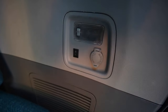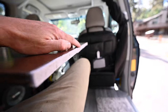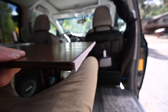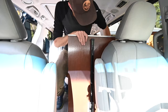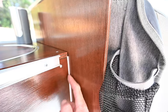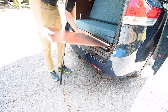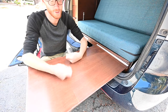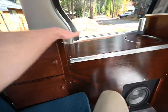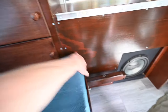Those rear lights are permanent — I did have to drill holes in the vinyl, both for the lights and for the switch. Another permanent feature is the curtain rail that I glued to the ceiling. I put little pieces of felt on the edge of the table so it can slide on the floor nicely, and also a little piece of felt on the edge of the cabinet to slide without scratching the wood. The table can also be used in the back of the van very easily with the same mechanism. It works nicely with the chair — you can eat off it, play cards, work on a laptop. This is half-inch plywood, which I used for the bed frame as well.